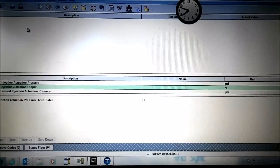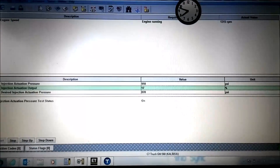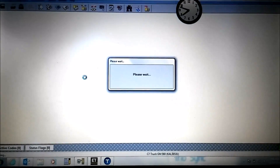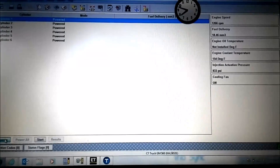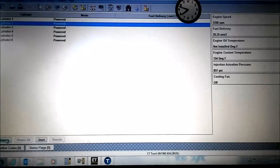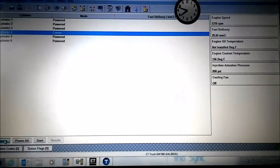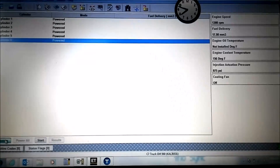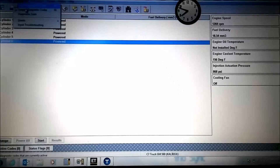Now this is a HEUI system we're looking at here. Another trick we can try on a HEUI system is to manually change the HEUI pressure and then do cylinder cutout tests at different HEUI pressures. Sometimes that will cause a weak or dead cylinder to reveal itself. I've seen them where at low HEUI pressures one or more cylinders isn't firing, but they operate fine at higher HEUI pressures — that means that cylinder's bad, usually the injector. You can also go really high on your HEUI pressure, test each injector, and that'll tell you if you have a weak injector. On most of the slightly older smaller engines that were HEUI systems, if you can go in and change that injection actuation pressure and test the cylinders, it's a good troubleshooting tool.